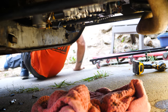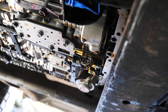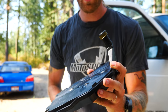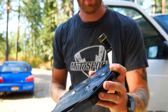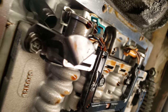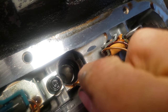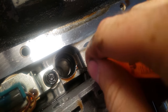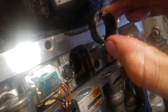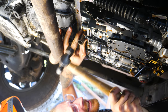There's one little piece we need to change located up in the bottom of the transmission, so we'll let the oil drip off a bit before sticking our face underneath. This little fitting goes with the new filter and needs to be replaced to make a tight seal. Since tranny fluid gets sucked through the filter, the old one is press-fit up in here. We'll have to be careful not to gouge anything, but with a hammer and a little pick the old seal will eventually pull out, and we can drive the new one in with a hammer and a socket.